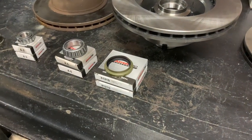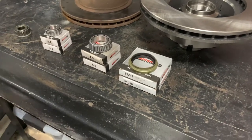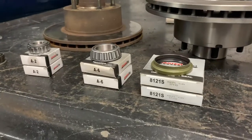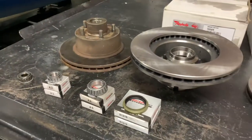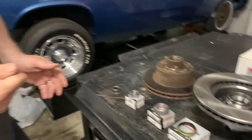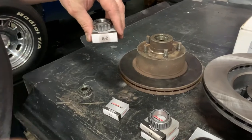After a lot of messing around, it turns out these parts — the A2, A6, and 8121s — are all accurate and correct for a 72 Mopar. But there's also a larger spindle that was available in late model B-bodies, and it's not uncommon that over the years people have gone to the wrecking yard and swapped in a different spindle. These cars are 50 years old — that's what happened to mine. I ended up with a late model big bearing spindle, and none of this works with the exception of the outer wheel bearing, which is the same between 72 and 73 and up.